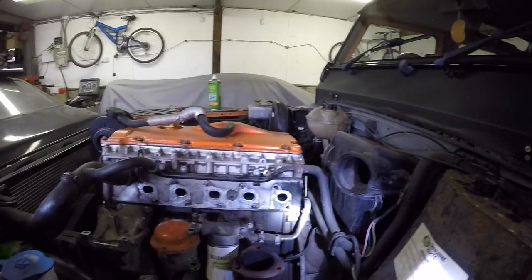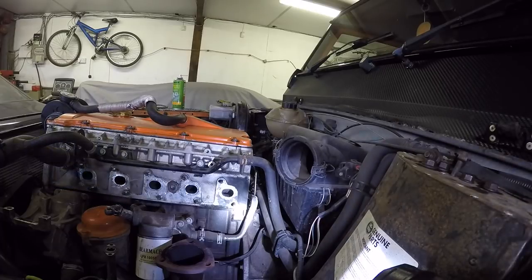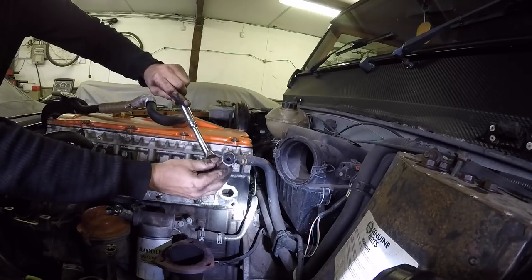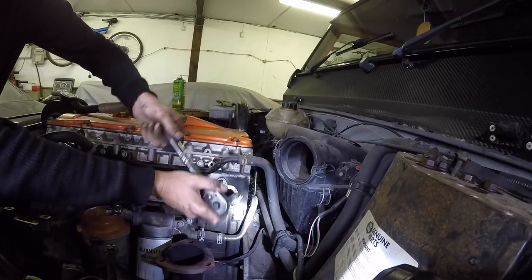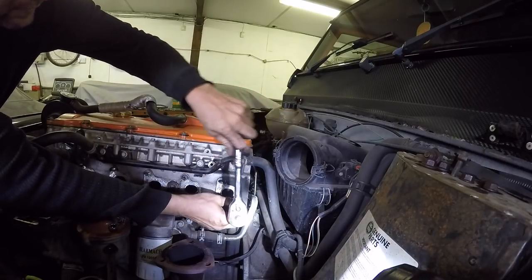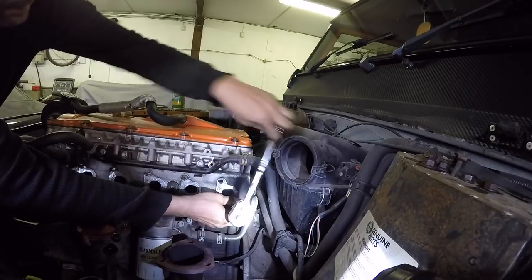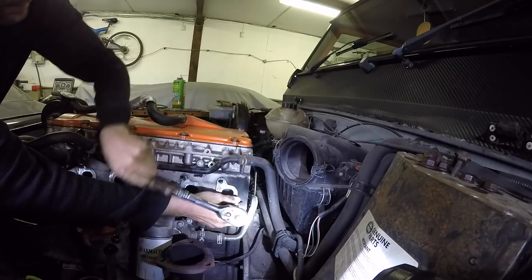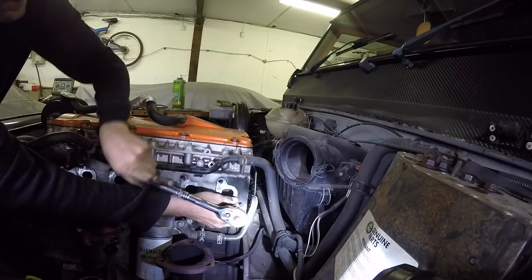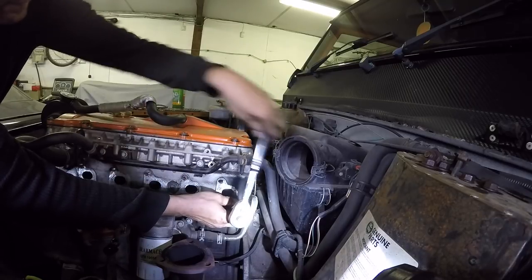I'm going to use a stud extractor to examine them rear studs because I'm not too sure whether they've been pulled out slightly or not. So let's use the stud extractor. It's just got needle bearings in it and it clamps onto the thread when you turn it. Hopefully it should extract and the thread should be okay, but it might have pulled it under the pressure and stripped the threads in the head, and then they'd have to helicoil it. So extract that carefully.